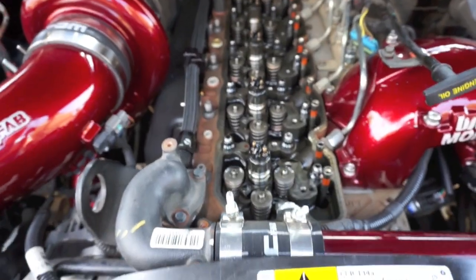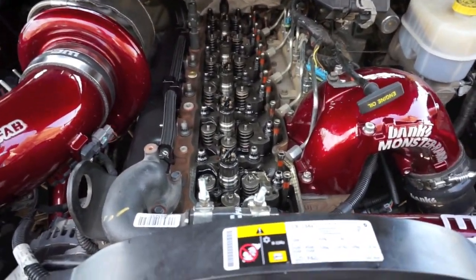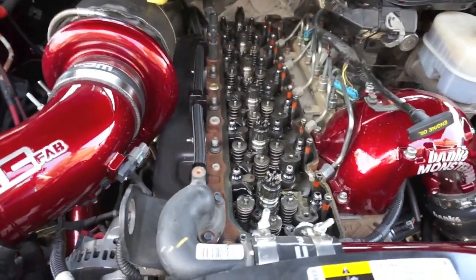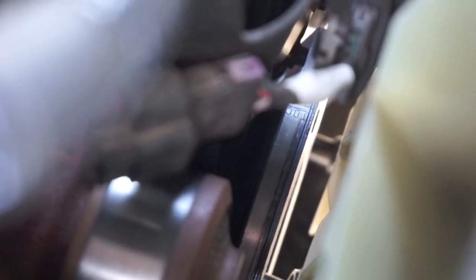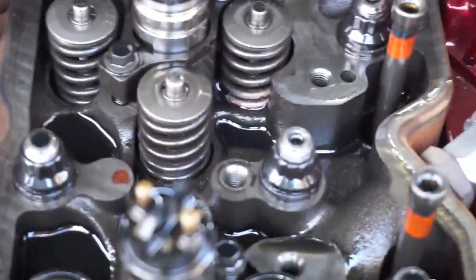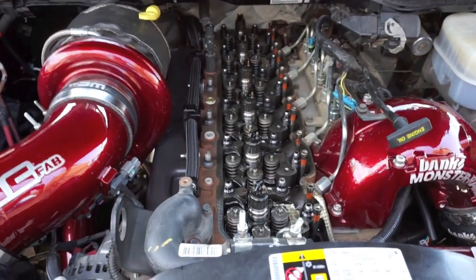I'm at a standstill right now — having my buddy come over with his torque wrench just to verify mine. Mine's got a little slop in the handle so I want to double-check it. What I did do was turn the crank to top dead center. I'll zoom in — you can see the TDC mark there. Make sure that's at the 12 o'clock position, and that's when you start testing your valve lash once I get the rockers back on.